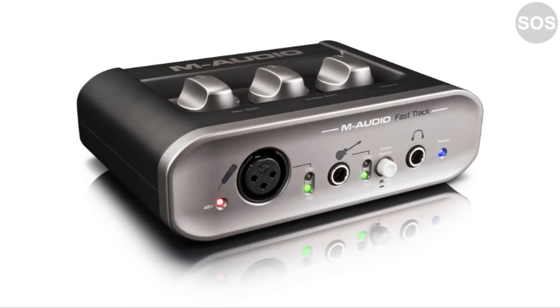For audio, you're also going to need a computer, a microphone, and I suggest getting an audio interface. Could you do this with a USB Logitech or Plantronics headset? Yeah, but does that look professional? No. The interface I have behind me is $500, and the microphone was about $150 when new. But for most people wanting to plug in one microphone or one instrument at a time, M-Audio has the Fast Track Mk2. This runs about $130, has phantom power, one XLR input, and one microphone or instrument input. It connects via USB — basically like a high-end sound card that takes proper XLR microphones and streams audio back into the computer with really good results.